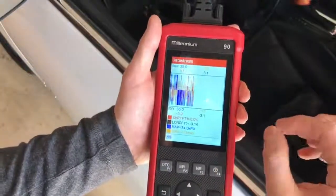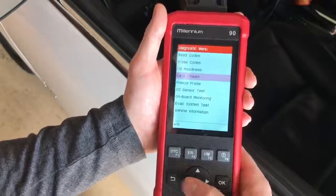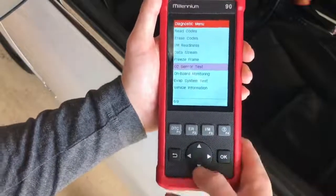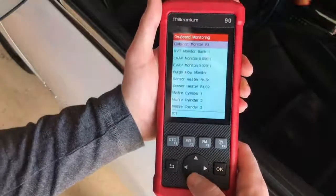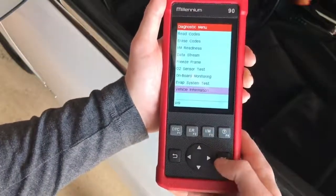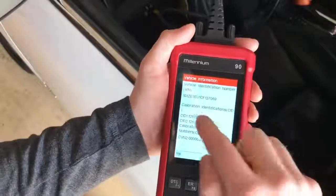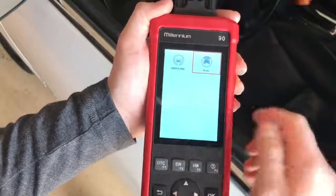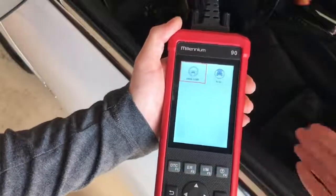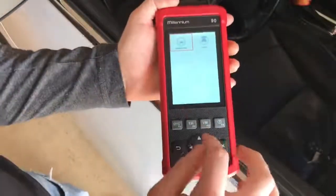The graphing capability is great but would be even better on separate graphs. You also have freeze frame data — probably nothing right now since there are no codes — oxygen sensor test, on-board monitoring, the EVAP system test, and vehicle information. In OBD2 mode it self-scans the vehicle and pulls up your VIN and all that info. In manual entry mode you can do those other tests, bi-directional commands — very limited but still handy.